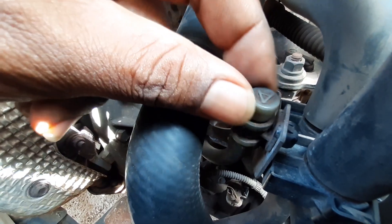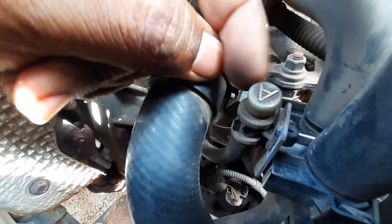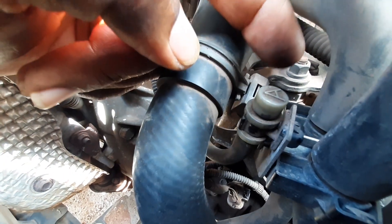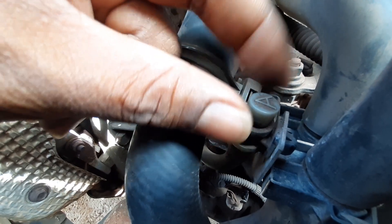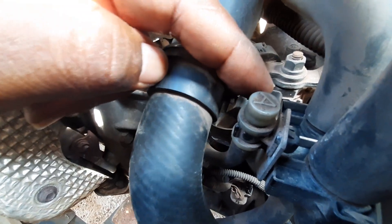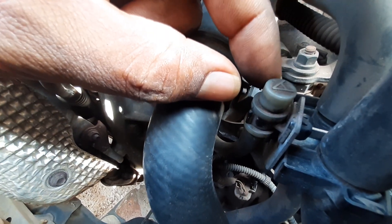This is how you can replace your breather hose cap. Especially if this part is broken — it is plastic and it can become crystallized, and if something hits it, it can get damaged. It's important to replace it because if water gets down into this, it goes down into your transmission, and you don't want that to happen.